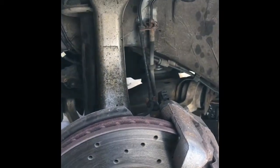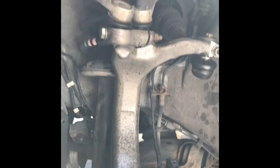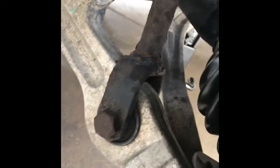Did the other side in like two hours, but I'm on jack stands and I had done it for the first time, so I'm guessing this side's going to be quicker. The thing we're going to be undoing first is this bolt here — stick an 18mm wrench on the other side and an 18 here, and zip it off with your impact.